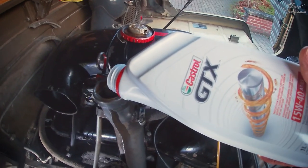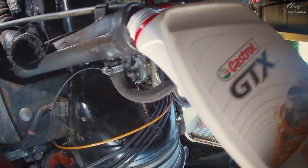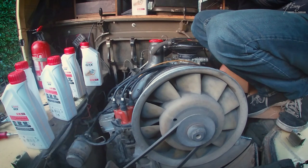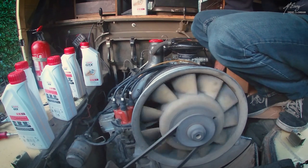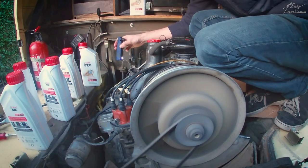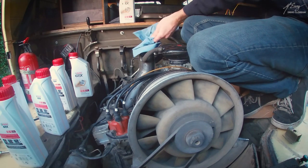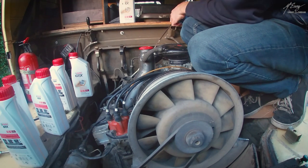Next, fill up with some fresh engine oil. The correct viscosity is 15w40. I received rather annoying packaging — a box of 12 one-litre bottles, which was a little pain, but that's all they had at the shop. While the engine is running, I do bear in mind at all times that there is that fan spinning right under my kneecap, so all caution is being exercised while checking for leaks. Check the engine oil level and top it up as necessary, as you would do with any other car.